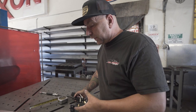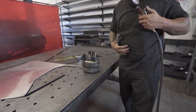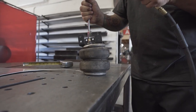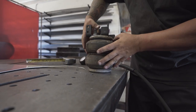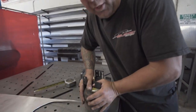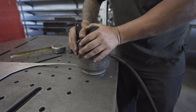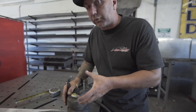Let's fill up this airbag and look at what it looks like filled up when you need to lift your vehicle. Let's say your vehicle is sitting two inches low in the back and you want some more height out of it. Normally this would be hooked up to a compressor or you'd have a line running to the exterior of your vehicle. Here's the thing about an airbag — now you're going to have a natural resistance. So when your vehicle is driving, it's not really driving on the spring as much as it is the airbag being used as a crutch or cheat in order to get the rear of it up.